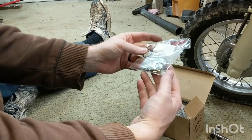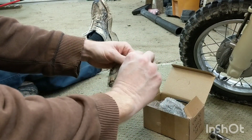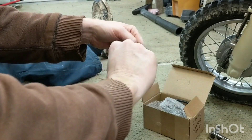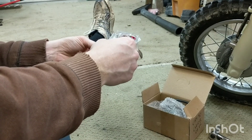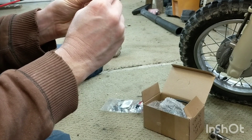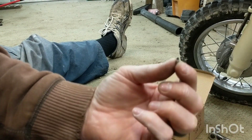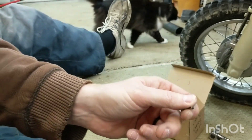Let's see if we have another one of these floats around. I always save all my parts. This was the OEM carb rebuild kit I tried first before buying the aftermarket carb. I can see the float needle in here - it's still soft enough. The tip is not enlarged, so we'll go with that.